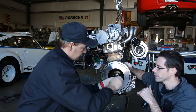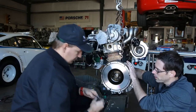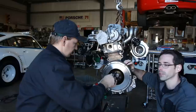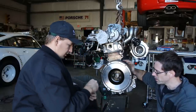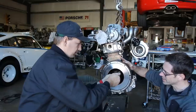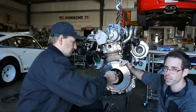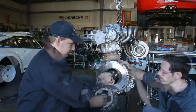While Cody is getting all the flywheel bolts in place, this is our South Bend assembly — this is the flywheel. This is a single mass flywheel. Normally from the factory on these vehicles you're going to have a dual mass flywheel. Single mass flywheels are a better setup for performance because they are less complicated, lighter, and overall just have less give for performance. There is a little bit of a downside in the fact that they do make a little more noise than you would get from a dual mass flywheel assembly.